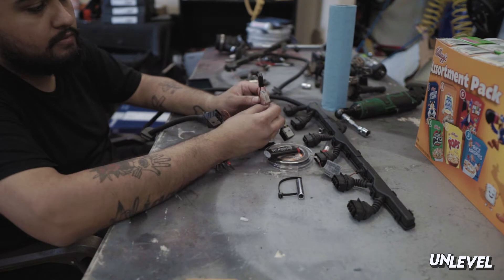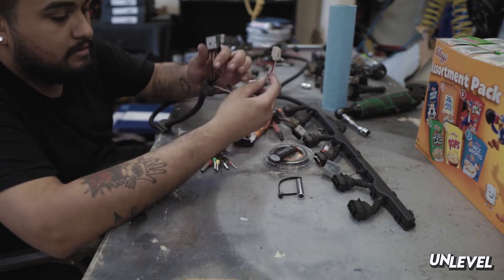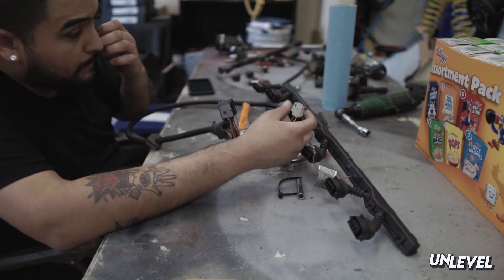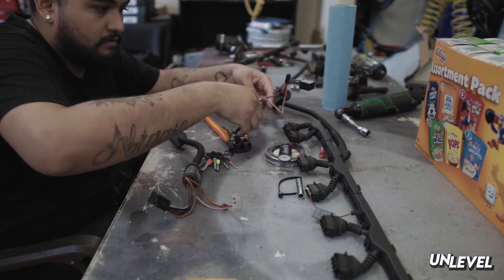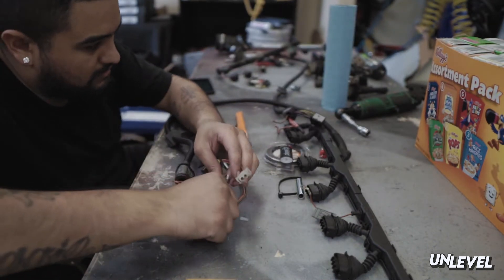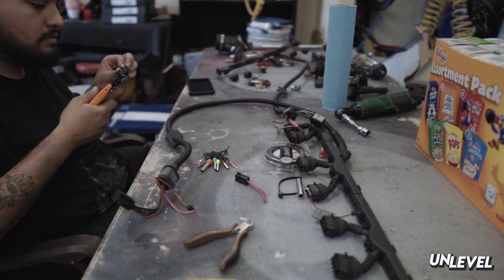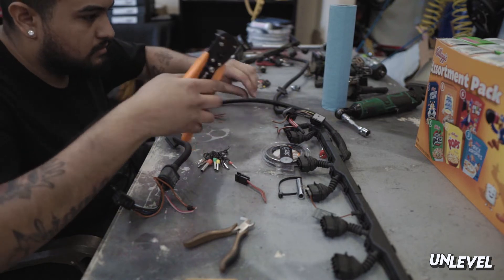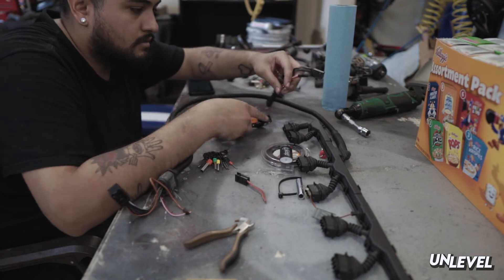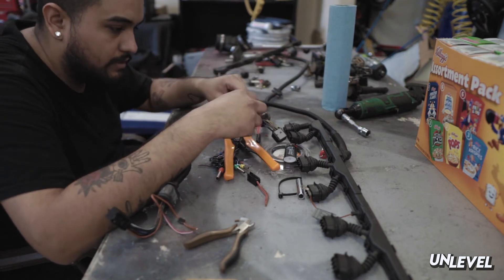This is the MS43 harness with the older coils — that's just the way I'm doing it. I'm going to chop this off and splice them together — ground with ground, red with red — like this. Don't forget your heat shrink.